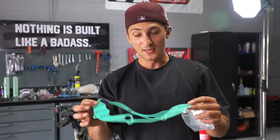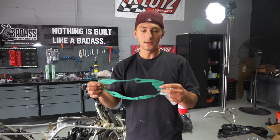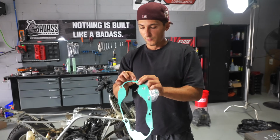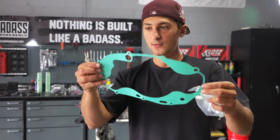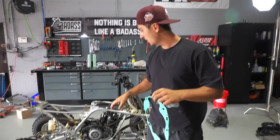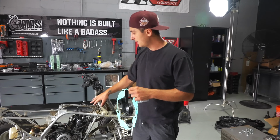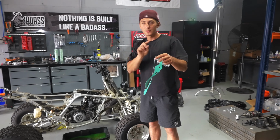So now you need a clutch cover gasket. And where are you going to get that? BonziGarage.com. The best gaskets other than OEM. They have a little rubber sealant on the front and back side, so they seal really nice and don't leak. And sometimes just for security, depending on how many times the clutch cover has been pulled off of a bike, sometimes people try and pry it off with a screwdriver, so it leaves indents. I'll go with a little bit of silicone around both sides.